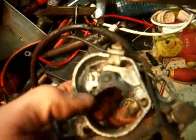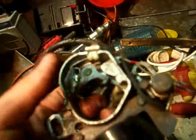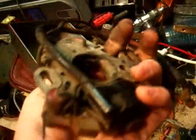This here is a points system. When this is pushed you can see the points open. To adjust them there's a screw down there — you undo that screw and swivel the points back and forth with a feeler gauge in between, getting it so that when the points are in the open position it reads the right specification. Your condenser can also go bad, sometimes causing no spark depending on how bad it fails.